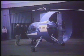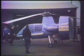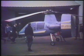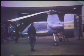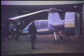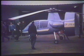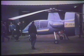And it's now a stress skin, just a regular Cessna type construction. And a very, very much improved visibility as well. And the engine was upgraded to the 200. We actually had a fuel injection IO 360 at this point to give us 200 horsepower. Now, we departed from the Cessna-type landing gear. These legs hinge at the side of the fuselage and act on rubber blocks. I think the twin Otter has something like that. That's relatively simple, but really the Cessna-type legs are still really simple, but this was what we ended up with anyway. And this has the Armstrong blades on, which have the twist in, which we don't really want.